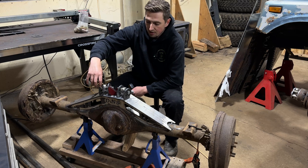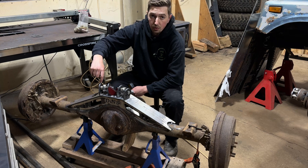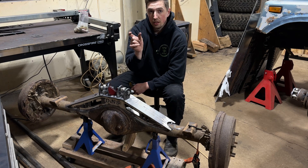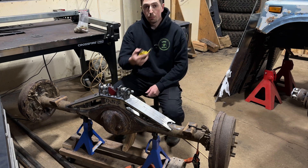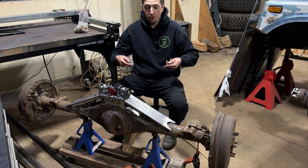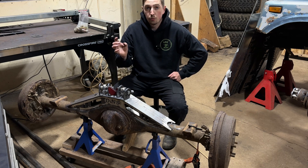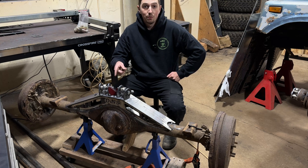We're going to cut the back pieces for a little bit of extra support for the structural lateral movement of that mount. I do have some pieces of steel in between my misalignment spacer and the mount itself. That provides a clearance fit for these heim joints — the heim joints from surface to surface on the outside of the misalignment spacer is exactly two inches. On some previous mounts I found it was very hard to get those rod ends back in, so I'm putting a little clearance washer in there. I'm going to start tacking this together and finalizing this truss.